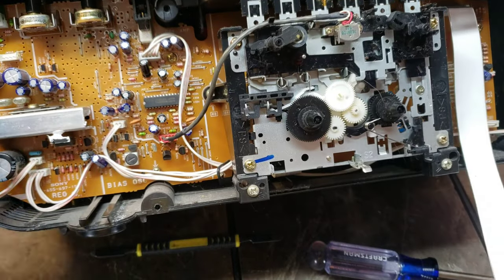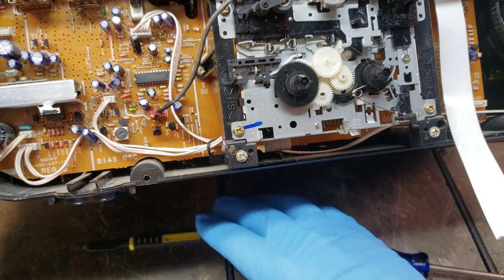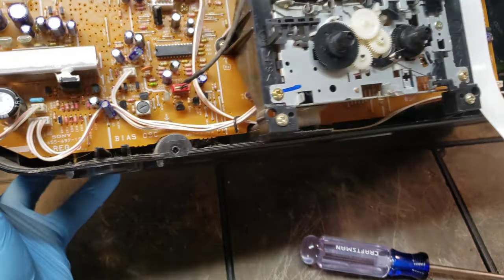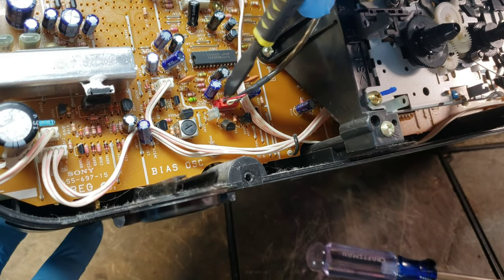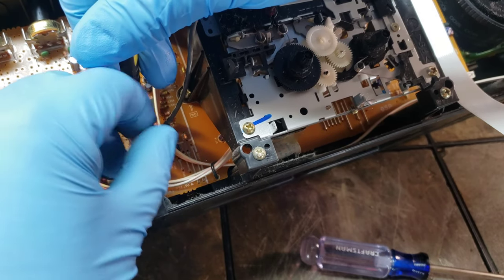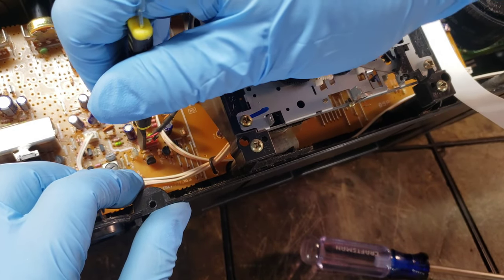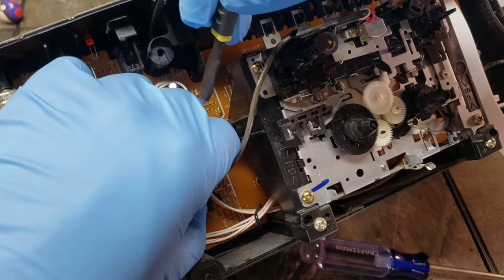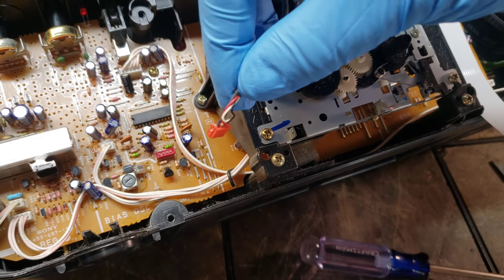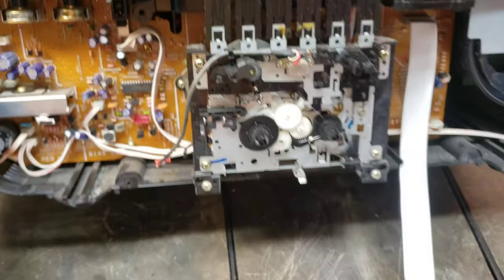This doesn't look like it's going to be too bad. We do have to disconnect the main lead going into the tape head — that one I don't think you can just wiggle. I think we're going to have to take something sharp and pointy. There are little tiny clips right there on the ends and I think I'm going to have to kind of pry one open and try to get one side, then the other. Actually it's just one side — and we got it. There's a little clip on the side, you just have to kind of bend it over.